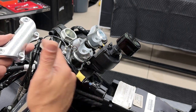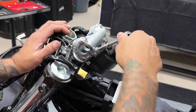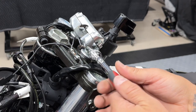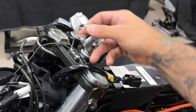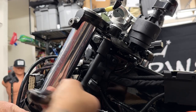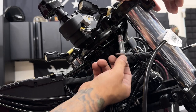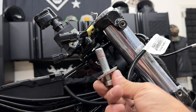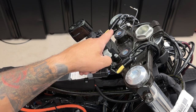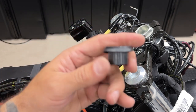So now to remove the bushings, I'm going to reinstall the top clamp so these bottom clamps don't spin when I'm removing the screws. So now I'll move this ground to the bottom clamp so it doesn't get damaged. For this screw, it's a 5/16 socket. I'll just thread the screw back in here so I don't lose it. Now I'll go ahead and remove both bottom screws. So here you have your screw with your bottom cup washer, then you have your two top cup washers. Just take those off. And then you have these spacers that sit in the middle, and then you have these rubber bushings. These are the rubber bushings that wear out over time, so that's why we're switching these out to the polyurethane bushings.